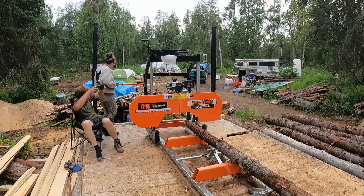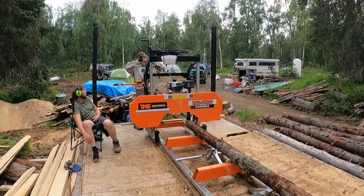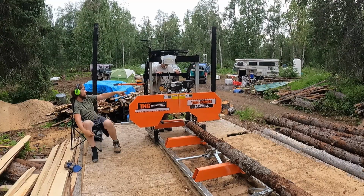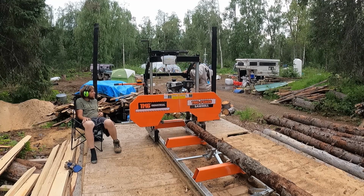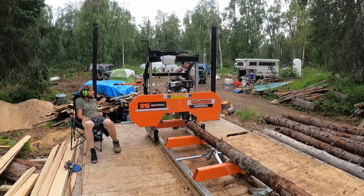This part I know. You do? Nope. Oh, turn the red all the way to the right. That's the fuel shut off. So that's on. And then pull it. You'll want to do the choke for the first one. Do the choke to about half, which is the black one right above it. Yep. Probably about there. Yeah, give it a pull. It should start up. Choke back. There you go.